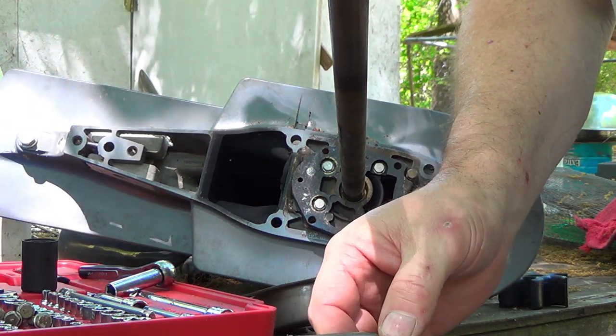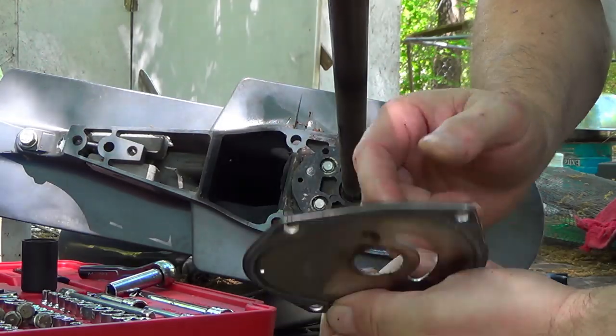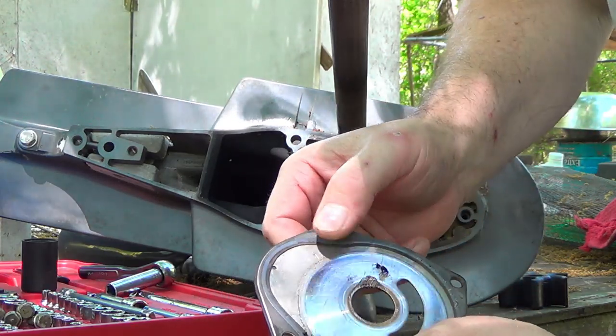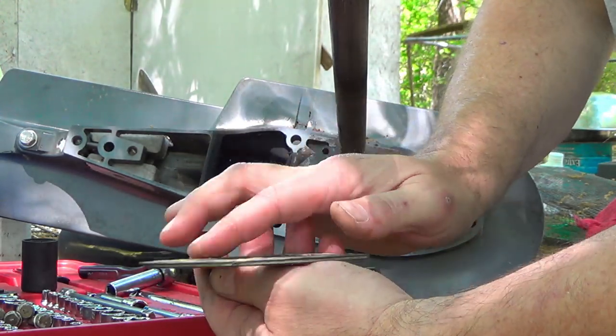The plate has a smooth side and a rough, sharp side. You always want to make sure that your impeller goes on the smooth side — it's pretty easy to see with the shiny side. That's where the impeller was at. We've got new gaskets in the kit.